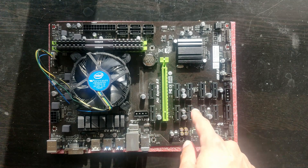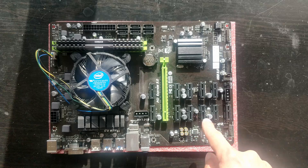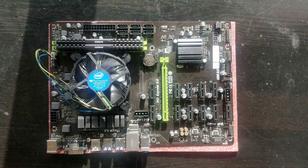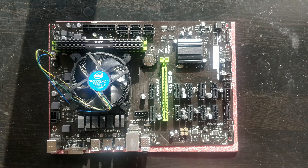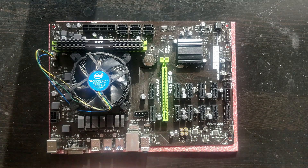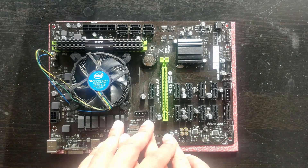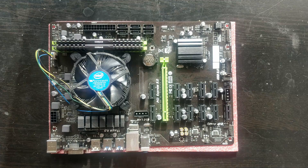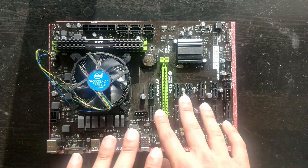Personally I have eight cards — three here and five here — and I haven't plugged in the auxiliary power. I'm using a mix of 3060 Ti and 3070s, with them at a power limit of 120 watts or 130 watts for the 3070s, and I haven't had any problems whatsoever, so I think you should be fine without it.